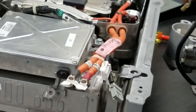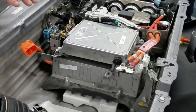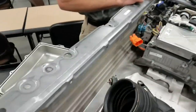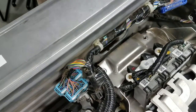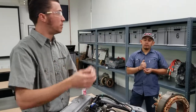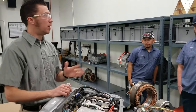Number nineteen: high-voltage DC coming in from the junction block of the battery module. Number twenty: you can see UVW coming out — it's a three-phase output that goes underneath the vehicle up to the actual AC drive motor. These are the cables you need to be careful of when lifting and racking these cars, because the lift arms sometimes have cups or pockets that you don't want contacting a high-voltage cable. Those cables are not repairable like SRS cables — they're very expensive.